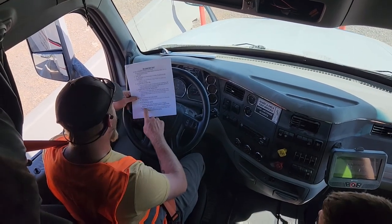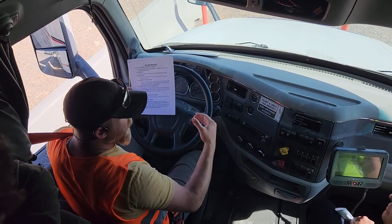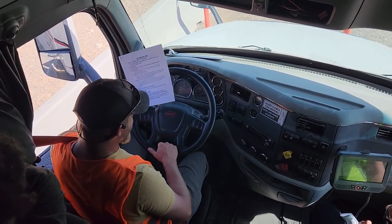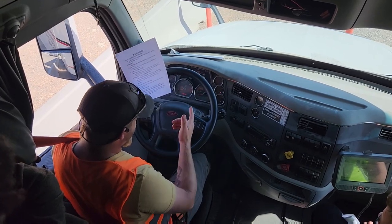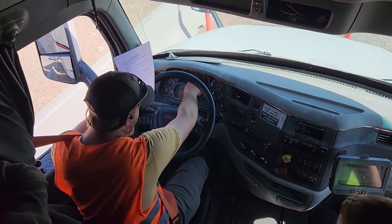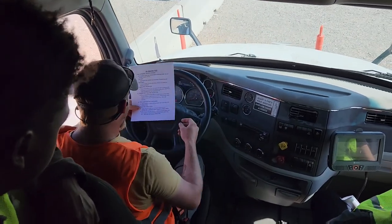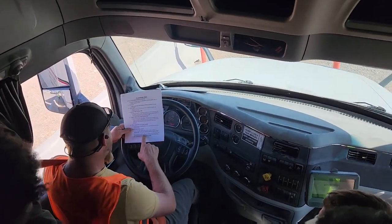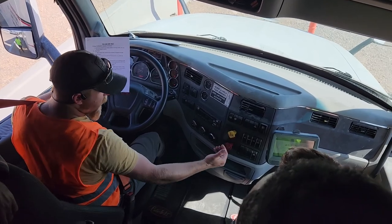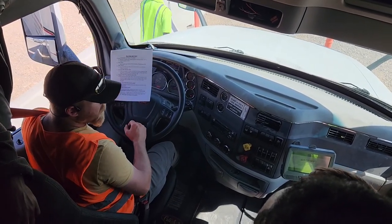Now we're gonna pump the brake pedal. You wanna pump the brake pedal and at or above 60 PSI, your warning light and buzzer should come on. Right there, 60 PSI. I got my light, you heard the warning, and it gave me the little warning indicator up there. So now that that's done, we're gonna continue pumping down until the red and the yellow pop back out. It must pop out between 20 and 40 PSI.